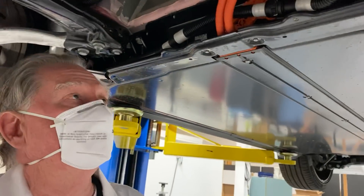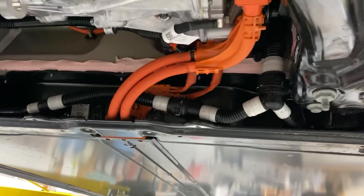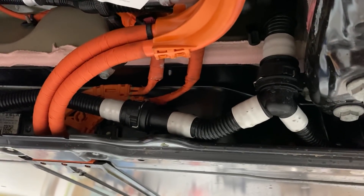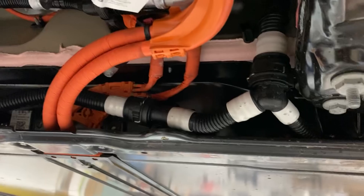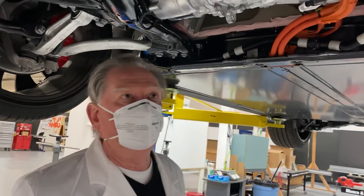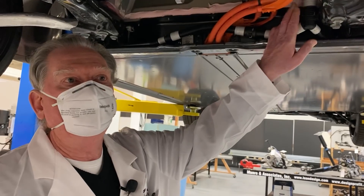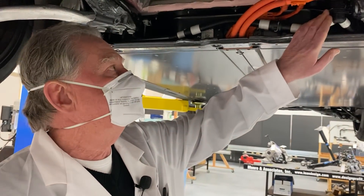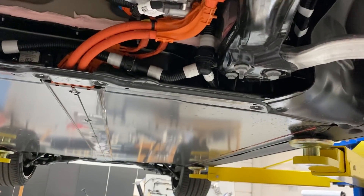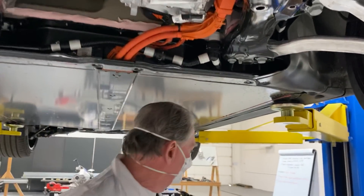Let's look over here at something else that I like. These are quick connects. They probably don't mean much to a lot of folks, but to me, when I was at Ford Motor Company, this is how we got rid of huge fines on air conditioning and whatnot by going to quick connects. People don't like to use them because they're much more expensive than a swage lock fitting or a screw fitting, but they never leak. These are 100% perfect all the time, and you'll see it's got a little clip here — when the clip goes in, that means you've done the job properly. Now these are two little things, but to me they're big things.